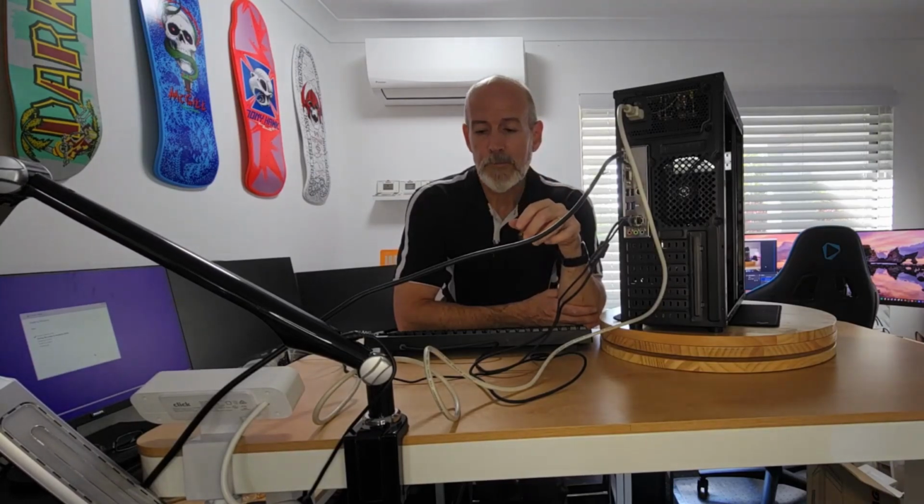The reason I like to do a clone when I can is because sometimes they might have some software that's a bit harder to get, or they, say they've got Picasa. Now, you can still get the files for that to install it, but if they've got like a complex library set up with all their folders and what have you, you've got to go and find the appropriate area files and copy them out, which is usually in like the app data file somewhere. Copy that out and then paste it into the new machine. So it's all doable, but the more there is to do, the longer it takes.